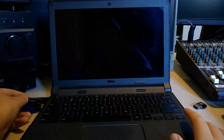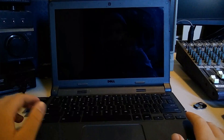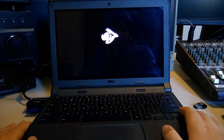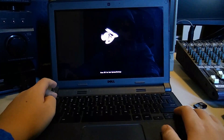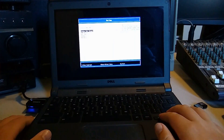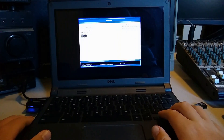Once it is completed, we can insert the USB drive into our Chromebook. Power it on and press Escape until the BIOS screen is displayed. Here we can choose which device we would like to boot from. We want to boot from our USB drive, so select USB.